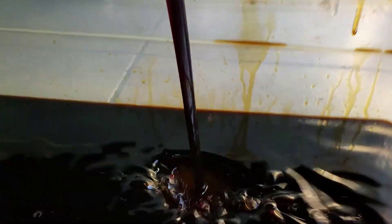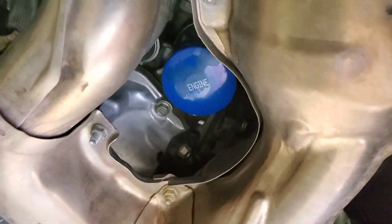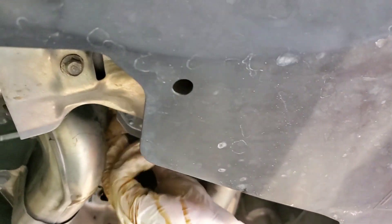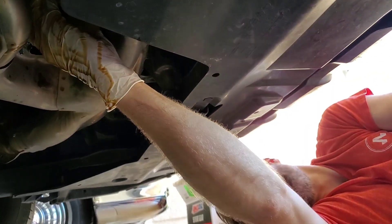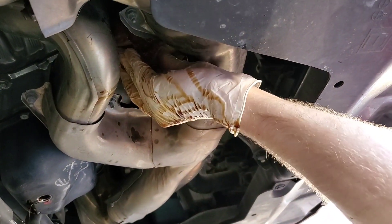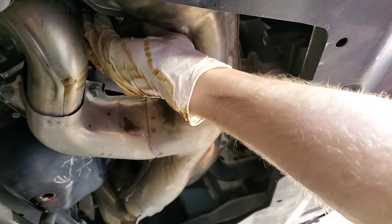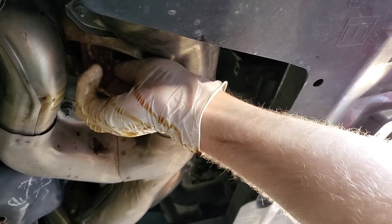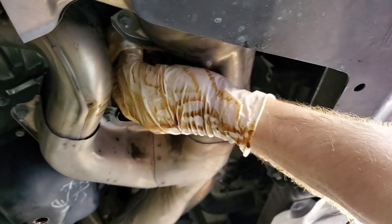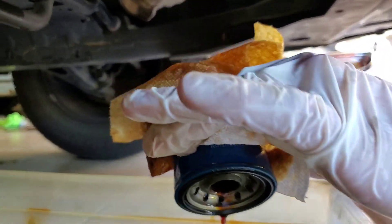You see it comes out like water, and it sounds like water. Now it's time to go ahead and crack loose our oil filter right there — very, very tight spot. Make sure you've got a good hold of it and don't let it drop. Keep going — we should be giving both hands to an oil filter. Is she coming? Almost there. There's a lot of threads up there. Some of them thread a half inch. Yep, and just dump it. Let the oil dump in there. There's our cheapy little OEM filter, and we're going to show you the difference from AMSOIL right now.